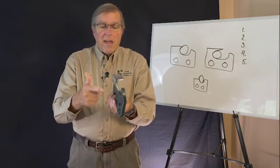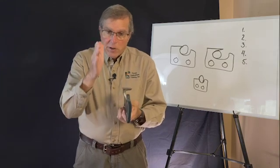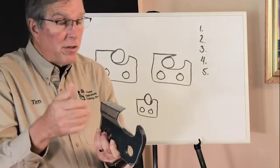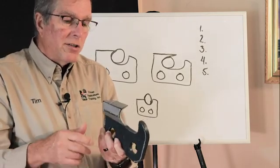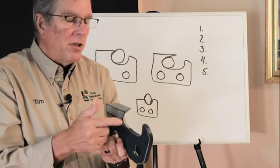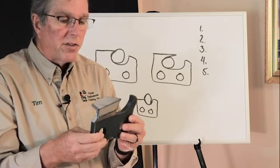And then also just having damage on the right side. The reason I know that is you could take a good sharp saw chain, brand new, and put it into the wood. It's cutting nice and straight. Take yourself a flat file, knock about 5 or 6 points off of it, put it back in the wood. If you made those damage points on the right side, it's going to cut to the left immediately, or vice versa. So those two things, the depth gauge and the point, can keep you cutting straight and also feeding into the fiber. Any damage on that working corner or point is going to start to decrease your cutting capacity. So we want to make sure that we understand that.